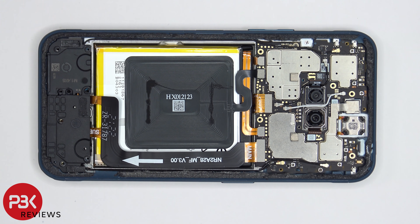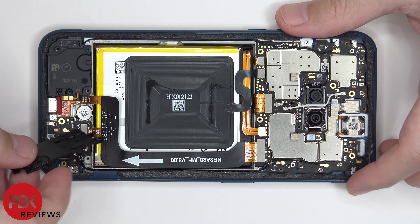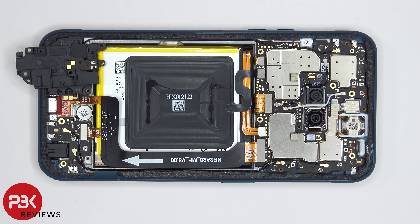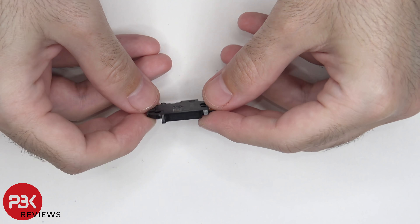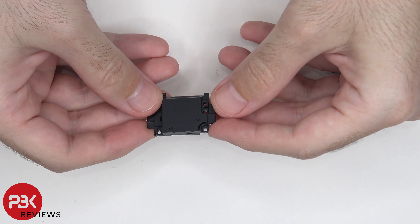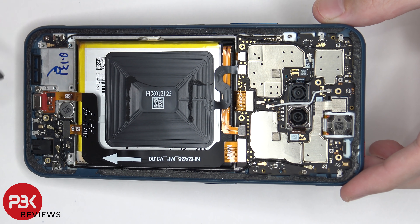At this point the battery cable needs to be disconnected. Once we remove this plastic cover, underneath it there's a flex cable which connects the speaker assembly to the sub board. These two contacts touch these two contacts here, and these two over here make a connection with these two, giving it signal. Now the speaker assembly can be lifted up and removed. Taking a better look at the speaker assembly there is a mesh filter or cover over the opening. On the inside of the frame there's also a rubber gasket by the opening for the speaker.